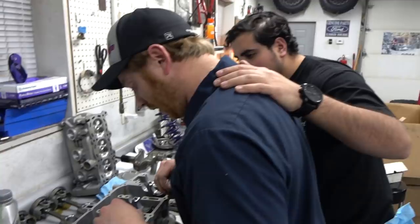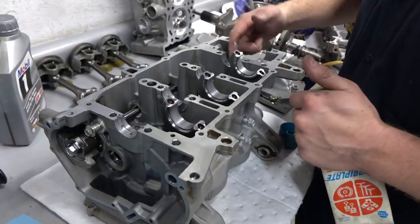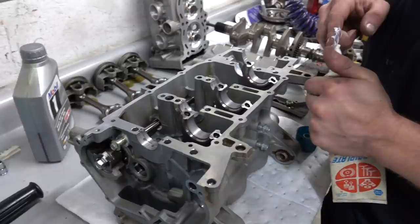What I'll do is we'll lube the bearings up, I'll push the pistons down, and then pull the rods back up after, so... Yeah, it turns out you're useless, sorry. Oh, toothpaste, huh? That makes sense. Yeah, you want to use Crest. For sure. Yeah, so toothpaste has got silica in it to clean your teeth. And silica will actually wear in the bearings quicker. It helps with break-ins. Yeah, you want a little grit in there.